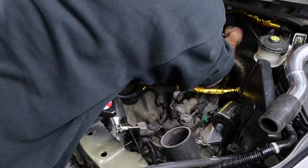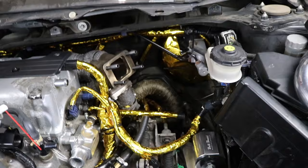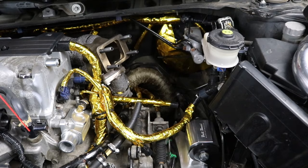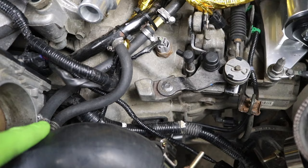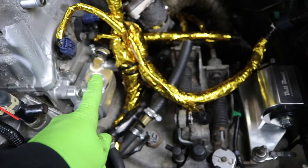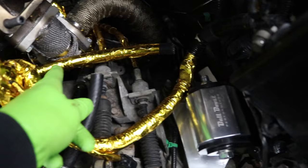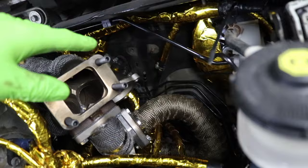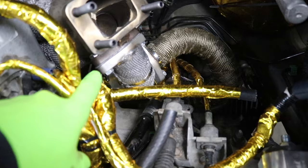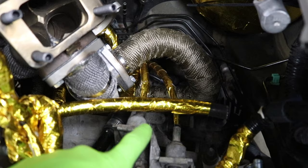I'll pause the time lapse for a sec just to show you guys a really important step. So far we got the 5/16 line built from the throttle body to this coolant pipe. We got another 5/16 one run to a 5/16 to 3/8 adapter fitting, which runs to a 3/8 hose going to one of the coolant lines on our turbo. Then we got another one coming off the 3/8 to 1/8 NPT barb fitting that goes to our upper coolant housing, runs back behind here, and that is going to go to another port on the turbo. I wrapped this hose with heat sleeving just because it is going to be close to the exhaust. The heater hoses on the back are completely made.